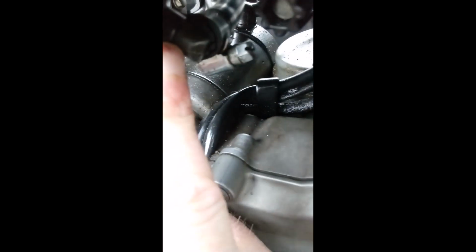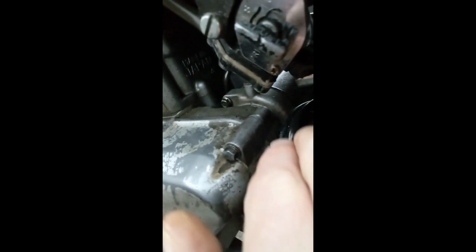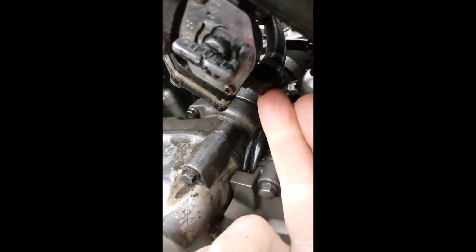So yeah, that's kind of it really. One little footnote. The only hurdle I came across, apart from the fact that one of the bolts that hold the old vacuum petcock on failed and I had to put a new one in, was this L piece that the exit hose attaches to, that goes into the petcock. When I was trying to get the hose off, that whole L piece popped out. I think there's a little O-ring there that stops flow. I managed to get it back in without taking the whole tap apart, and it isn't leaking, and time has proved that it isn't leaking. I was lucky there, but just be really careful with your hoses when you're trying to get them off. Don't yank them, because they'll just grip even tighter. Try and pry them off gently with a flathead or something.